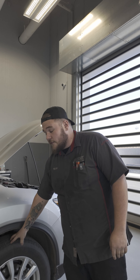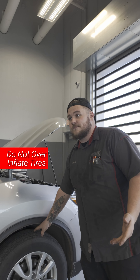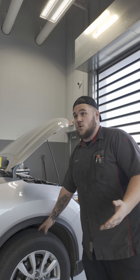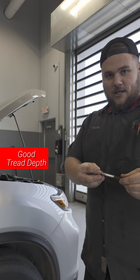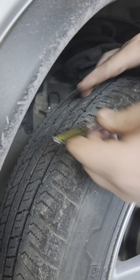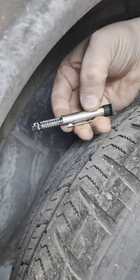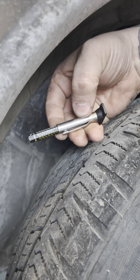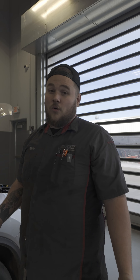Make sure that your tires aren't overinflated and always make sure that the tread depth is good, especially when you are going on trips or when you're expecting icy situations. Tread depth is checked by a tread depth gauge. I usually like to go on the center of the tire and this is measured in 32nds. It looks like this one has about 6/32nds left, so I would expect to change these tires in about 20,000 miles or two years.